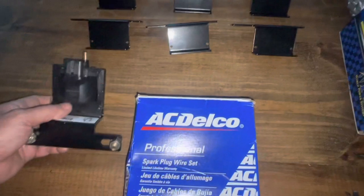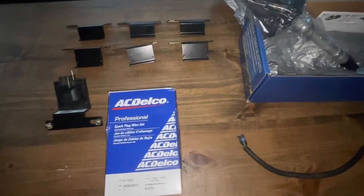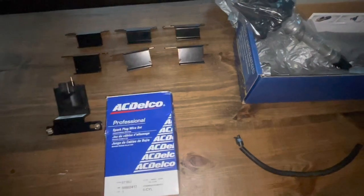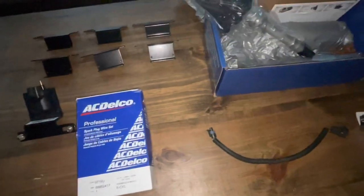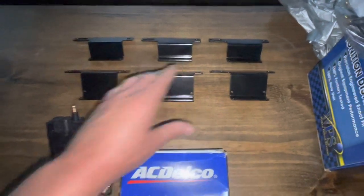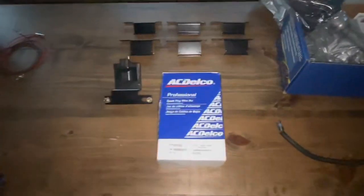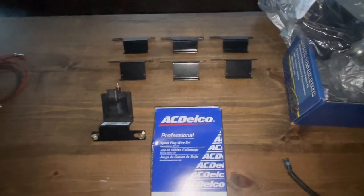By the way, this particular kit is for the V6, but there's a Delco EST system for the three-liter, the 4.3, the 5.0, the 5.7, the 6.2, and the 454. So there is a Delco EST solution for all those engines and I will sell all those kits. These are brackets I get laser cut, then powder coat, and rivet to the coil — brackets I make myself. I basically took the Volvo Penta design, which has been discontinued, copied it, and started making it myself.